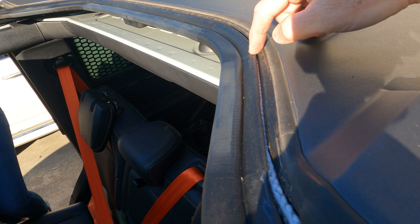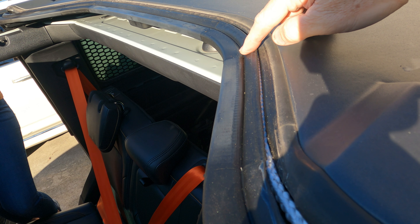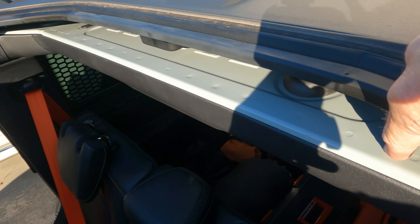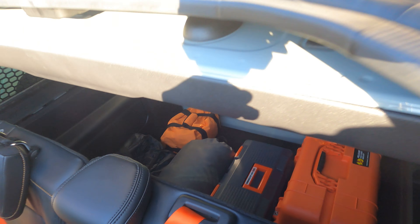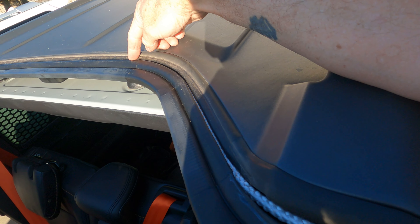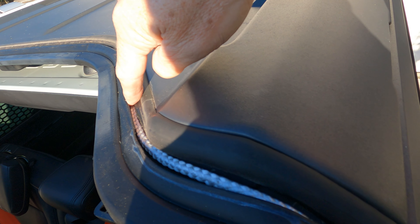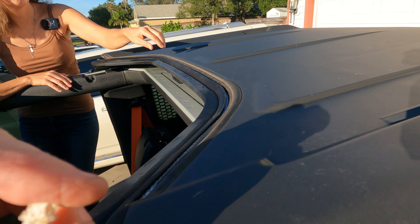When it's hot, the seal relaxed a little bit and dropped down, and actually created a hole where the water would go in and under, and drop right here. So it would drop onto this and then waterfall down into the back of the car. So what it's supposed to do is go in this channel right here, then run along this edge, and then go all the way down. What we ended up doing is — this came out a little bit — we got a little piece of rope.